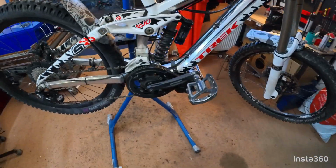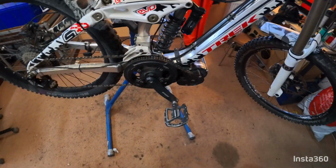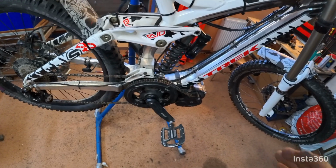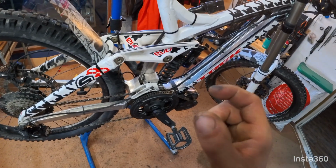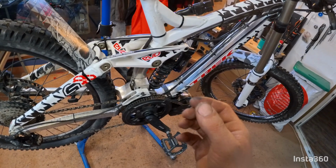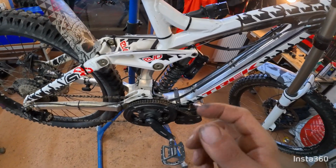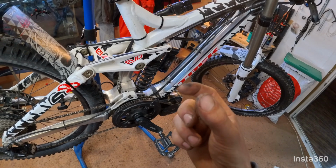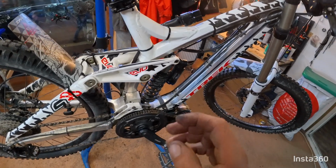So actually I did put the chain tensioner right now back in and cleaned it first up and everything, and I just saw it's still destroying a little bit itself. So the spacer, which is in the middle, like the original CYC spacer, it's rubbing. So I might build one with 2 ball bearings on each side of the chain tensioner, so there is no rubbing action.